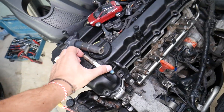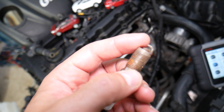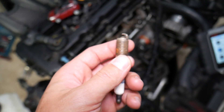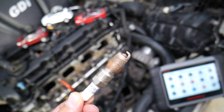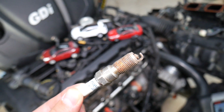Number one cause: spark plugs. If your spark plugs are worn, the gap is not correct — it's too big or too small. Usually when they wear out, the gap will become bigger, or if they're faulty, that can cause misfires. We have a special video about spark plug replacement and setting the gap on our channel.